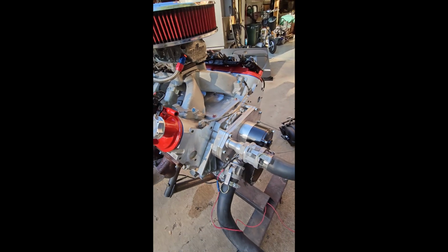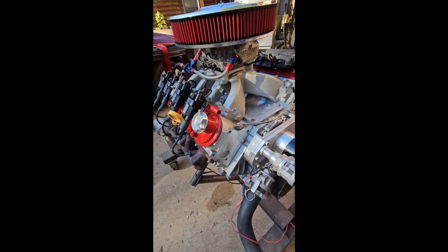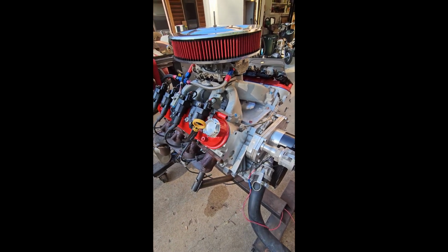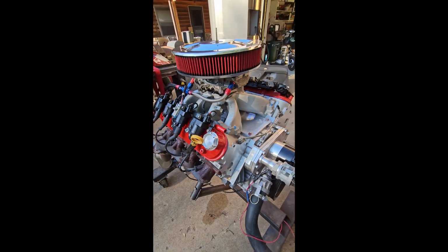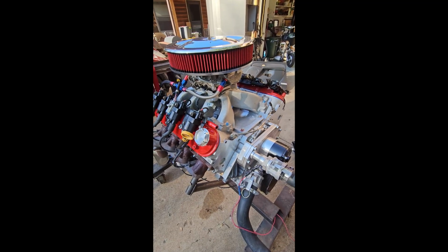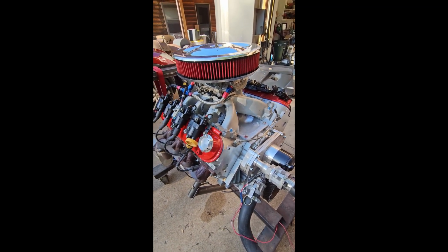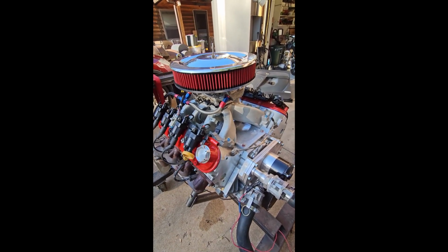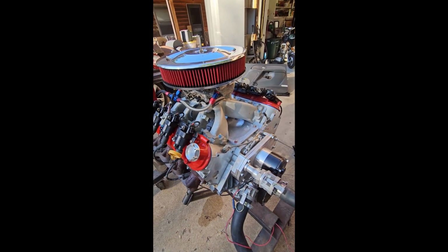It turns it into a 4-cylinder motor, and it causes the demise of 80% of these motors, actually, because the cams fail, because the lifters fail on the DOD lifters, and it takes the whole motor out of commission. So probably half of the motors that I have were all because of failed DOD. So I take that off of all the motors. No displacement on demand, no need for that havoc to happen later on. We get rid of all of that stuff.